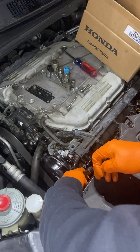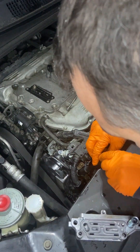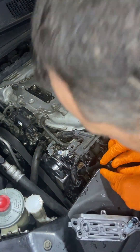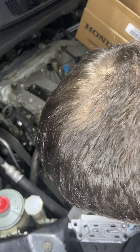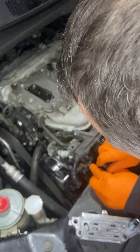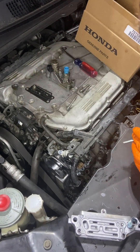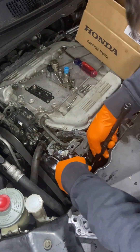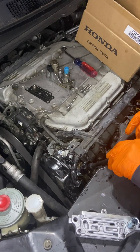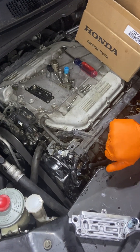The dealership wanted $1,200. They want you to take the manifold off, loosen up the rocker arm, and do a valve adjustment — that's what you have to do if you replace the whole lower part. I'd rather not spend all that money; then I'd just end up tinkering.